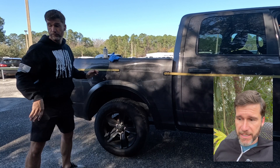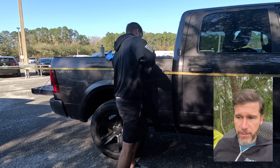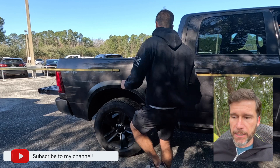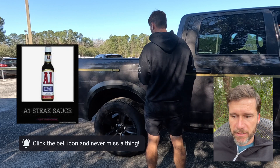Cleaning that area with alcohol. Now this is some cold glue — there's so much tension on it that the cold glue, you can see it moving a little bit. That cold glue did take a bulk of that depth out because of that tension; there's no way I could have done that without it. Just Google 'cold glue PDR glue' and you can find it. Galexo is a company that sells it, and you can get it at PDR tool websites like Anson, A1 Tool at pdrtool.com, or dentcrafttools.com.